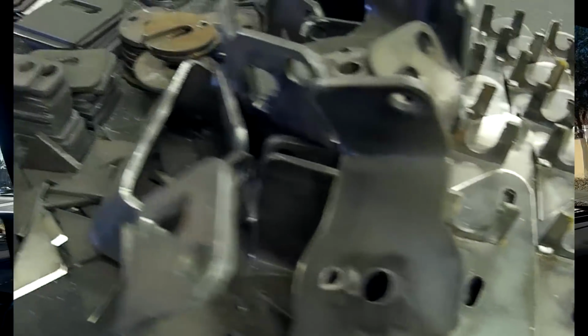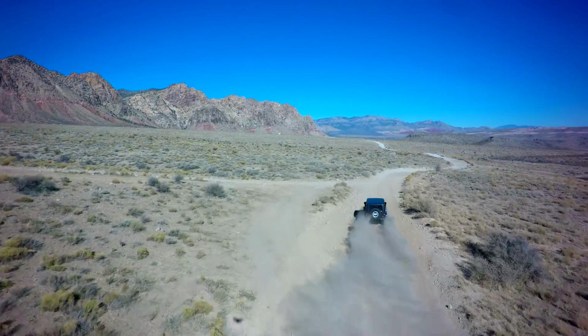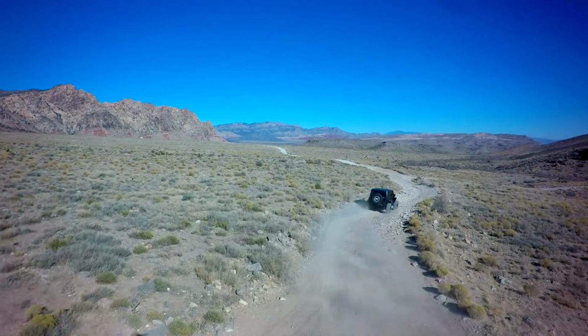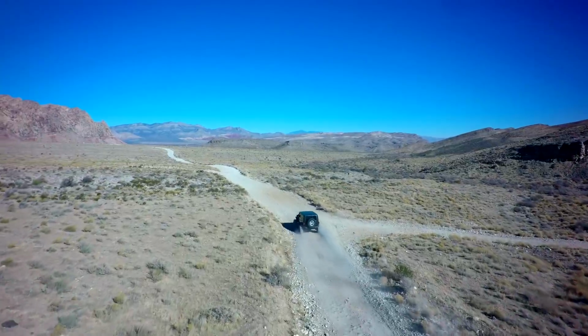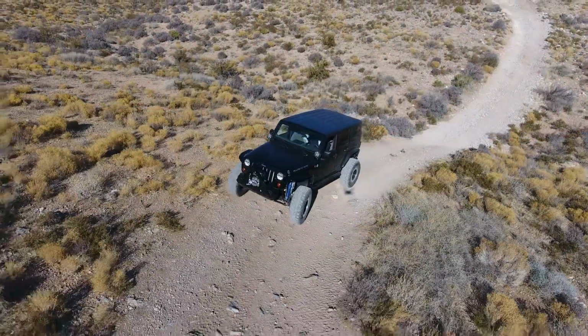One, there's no fabrication, so you save many hours of not having to cut off, smooth, install, and weld the other mounts. Now this is more important if you're going to do the swap with the body on. Not having to get into that cramped engine compartment and cut and grind is really helpful. Another advantage of the easy mounts is adjustability. Once the motor is in, if you've got to move it up, down, sideways, forward, backwards, that's available to you.